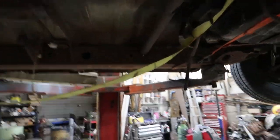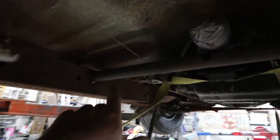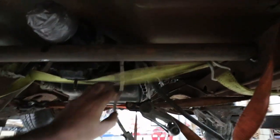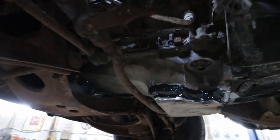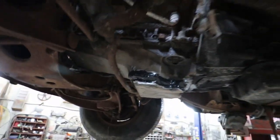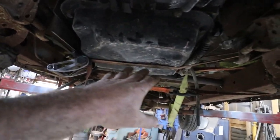That worked. So I just made this bracket here. I just tacked it in. I still have my straps as a safety underneath, but that allowed me to push the transmission back further, which gives me plenty of steering clearance. Even when you're turning lock to lock, it just clears. See if I can, oh, it's hard to turn from up here or down here. So, that part is good. We can proceed to make a mount in the back now.